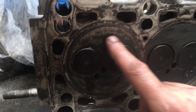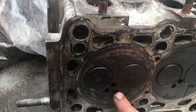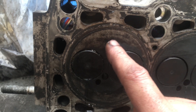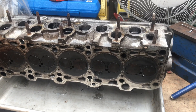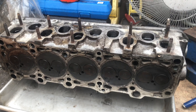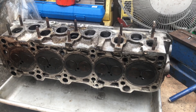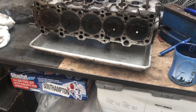What I have noticed is on this cylinder — so I said cylinder one but this is actually cylinder five. Cylinder five, the one with all the issues — all the carbon — it must have got so hot it's actually burnt all the carbon off. See these other ones, you can still see the carbon, but this one — nothing. Yeah, a little bit annoyed. Not a snapped cam belt — seized engine. Oh well, I guess I'll carry on and rebuild it.